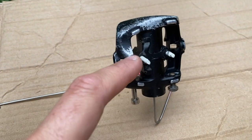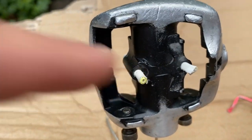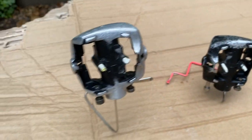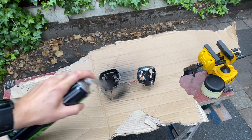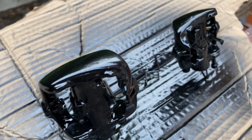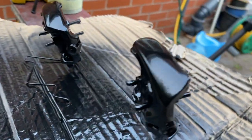These have been degreased, cleaned, and dried. As you can see I've masked off each threaded hole with either a plug of paper or an old bolt - four old bolts to fill the big holes and then little plugs of paper to fill the little holes. The little plugs of paper will also act as handles so I can spin these on the stands that I've made out of spokes. These can now be painted. Not bad for our first coat - 10 minutes between coats, probably do three or four just to make it really nice, and then we'll move on to the axles.